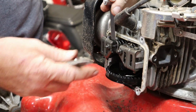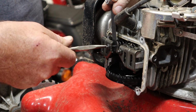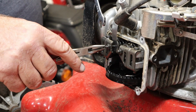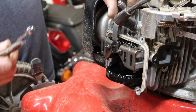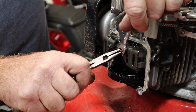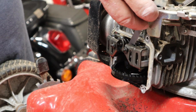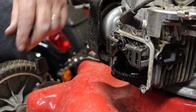We're just going to slide our feeler gauge in here, and then we're going to turn this until it starts getting bound up. Really close. I was turning it a long way for valves, so this thing would have rattled like mad. You probably couldn't hear it over all the air and exhaust and everything else, but we'll get it set up so it's better. There we go. It's a very, very light drag. That's what I want. Yep, there we go. That's pretty good. Now we'll clean this cover up and get some sealer on it, and we'll slap that baby back on there.